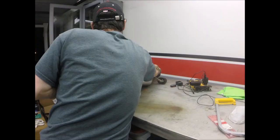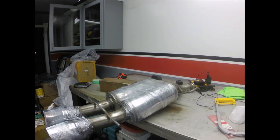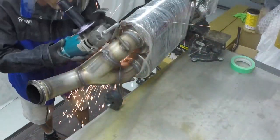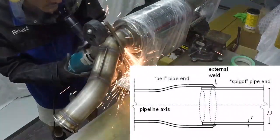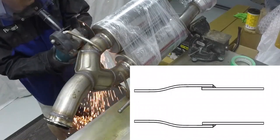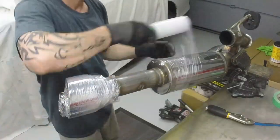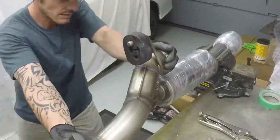The first step is to remove the mufflers that came with the kit. I'm wrapping them with shrink wrap before I start to try to protect them so I can put them up for sale on Craigslist later. A bandsaw would make this job a lot easier, but the exhaust is welded together using lap joints. It's a quicker, easier way of fitting mass production pieces together compared to the traditional butt joint you'd find in a custom-made exhaust. The easiest way to disassemble a lap joint is to cut the outer tube right at the edge of the weld. I was able to get most of the tube cut with a grinder, but depending on access, or if you don't own a grinder, you might need to use something smaller, like a Dremel with a cut-off disc or even a hacksaw.